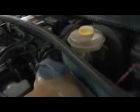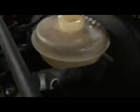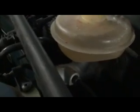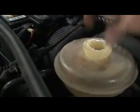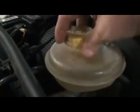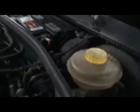What that does is on these Volkswagens, you stick it in here after this comes out. It's just a filter. You take the filter out, stick that down in and just snug it up. Pump it up until it just gets a little bit of pressure. Go to the farthest bleeder, crack it. And what I'll do is I'll fill that full of brake fluid and put, you know, half a dozen drops of food coloring in there to make it a bright red. Put that in there, bleed it until I get bright red fluid out of the farthest bleeder.